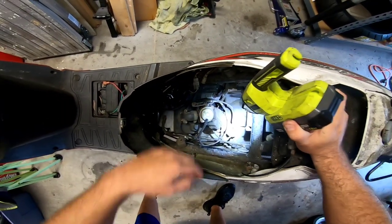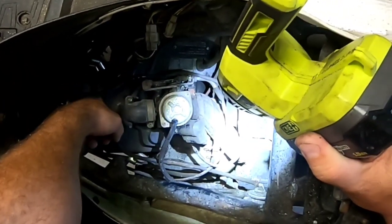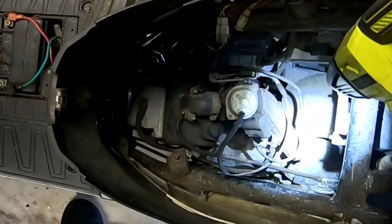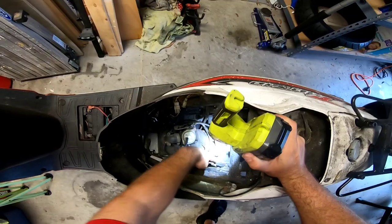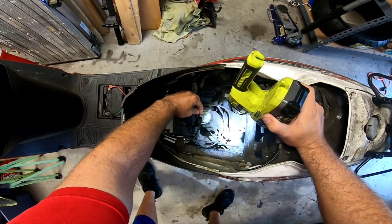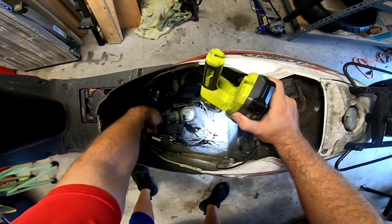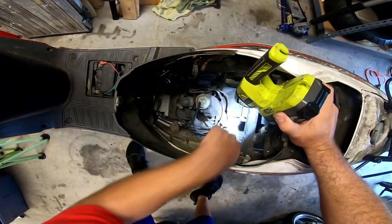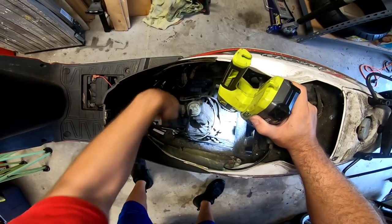So you'll be eliminating the petcock fuel system - that piece right over here. That would alleviate basically any of these vacuum lines, so you would be able to cut these vacuum lines - this one and this one - and plug them with a nail, a screw, or get vacuum caps. Then all you're doing is taking your main fuel line that's on here, routing it up underneath the scooter seat, and plugging it right directly into that gas tank. Now it's a gravity-fed system - you completely cut out needing any of this extra stuff.